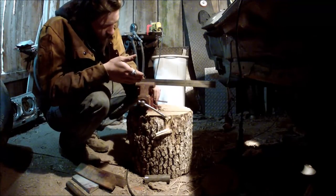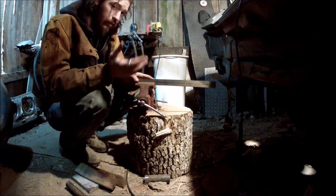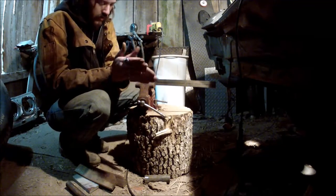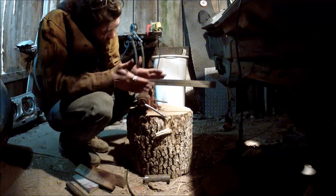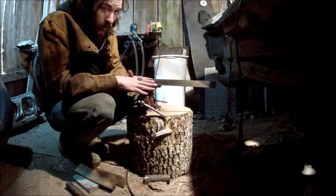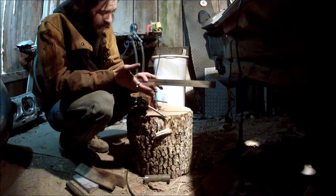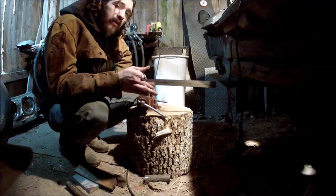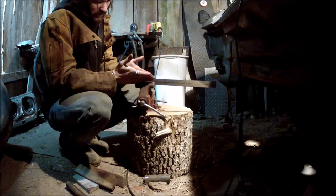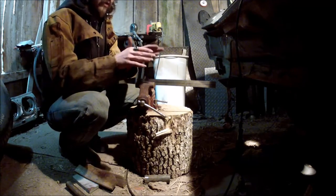When you do this, you're going to want to get your piece of steel in the vise a little bit higher than the actual line, depending on which way you're going to bend it — that way when it folds over, you don't get off the center. I've got the vise clamped just below the line, so it's just about even with it, maybe a little less, so when I fold it over it'll go right where it needs to. I'll probably use a mixture of a regular hammer and a rubber mallet, and after I start folding it I'll have to slide the piece along and continue to hammer it so it doesn't get a real uneven crinkle in it.